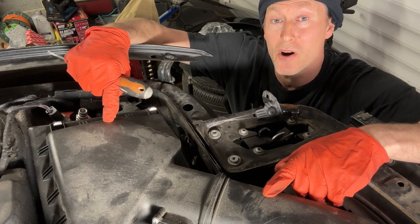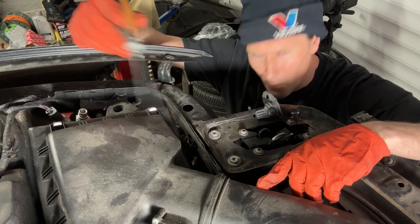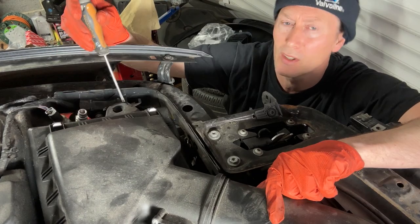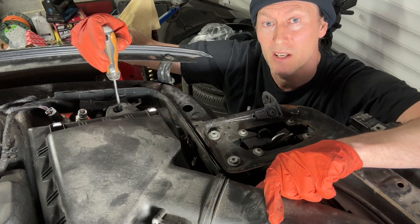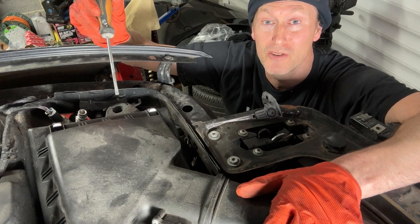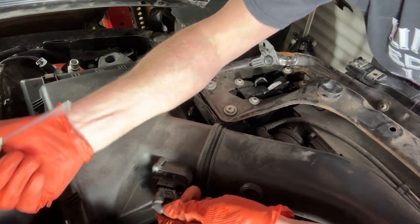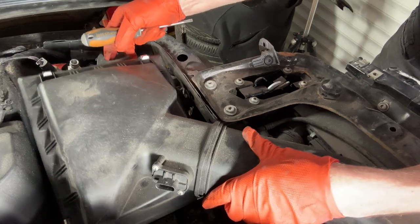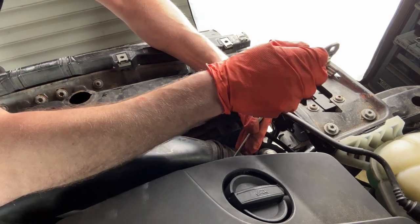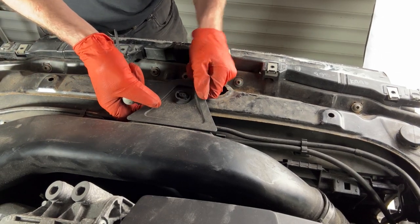I'm going to lift this air box out because I don't think I'll ever get the intake pipe on properly, and I want to check that everything's alright under it because it's loose at the moment and I haven't touched it. This bolt round here is broken - I don't know if I can do anything with it, there's a tie wrap round it. It seems like the previous owner had a good supply of tie wraps and was going to use them all. I'm just going to take this sensor off first, and then there's just a jubilee clip to loosen off, and this fitting will just lift off.